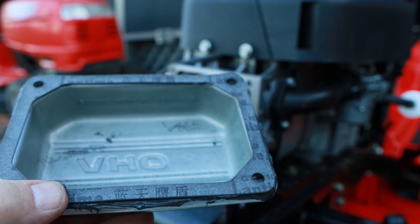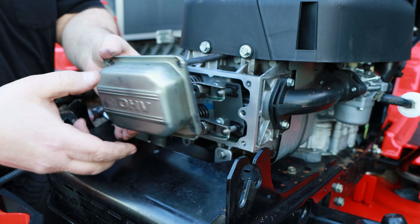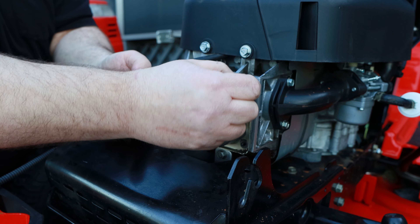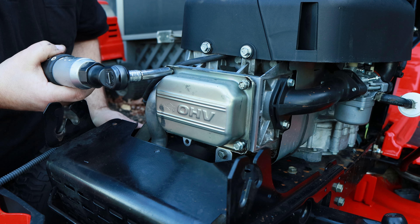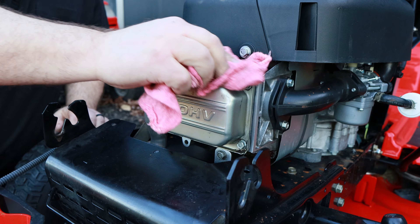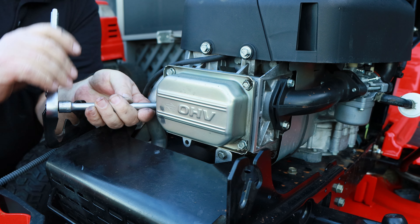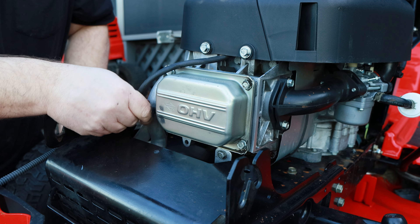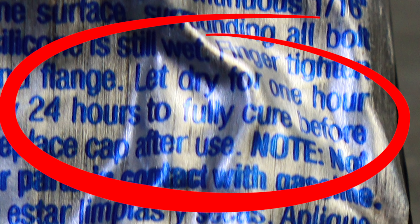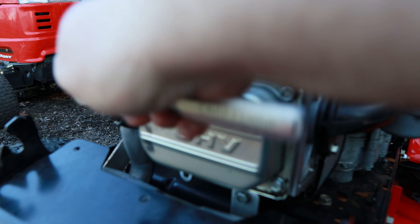If we follow the directions on the Permatex, you want to bolt this on loosely and then come back later and tighten it down. When you put this back on, pay attention to your OHV so all your data and everything's on the top — it will fit on there upside down and it won't hurt a thing, other than the fact you won't be able to see your information. Get all these started and snug these down but don't fully tighten them yet. Take your rag and wipe all that excess Permatex off while it's still wet. While we're waiting on that to set up, put the spark plug back in and the spark plug wire. I read the directions on the Permatex after — it needs to dry for one hour and is 24 hours before it's fully cured. Go ahead and snug that down. If you tighten it down too much, it'll squeeze that gasket out and damage it.